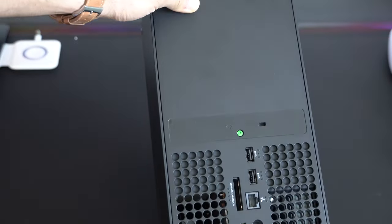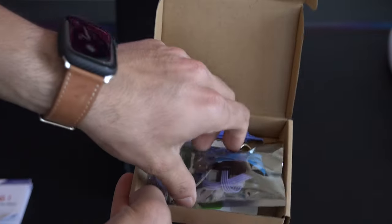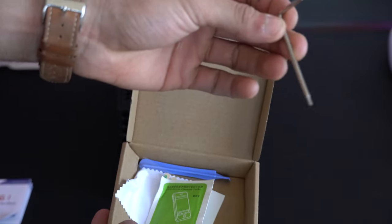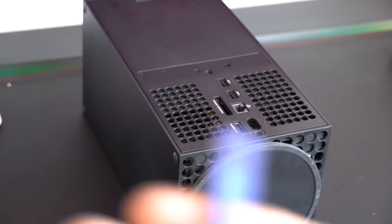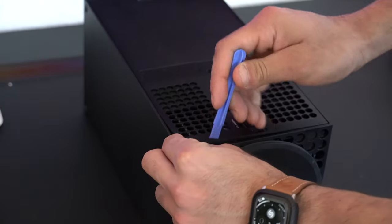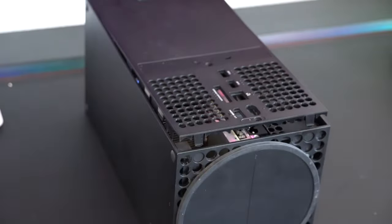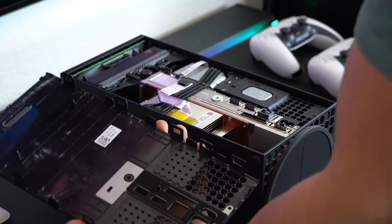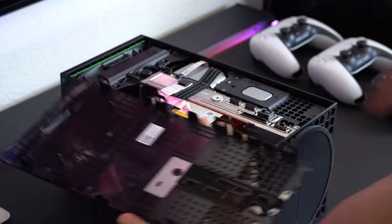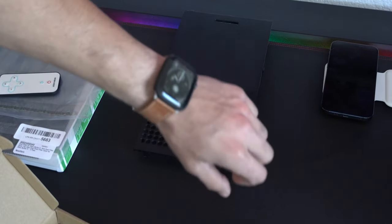Once removed, the screws are actually green, which is quite interesting. They provide everything you need inside the box — everything is included. Set everything aside and start the disassembly. Using the included T8 screwdriver, remove both screws. Then grab the plastic trim removal tool and almost like a crowbar, pull it out, holding it with your finger. Do the same on the other corner — there are two clips keeping the back plate together. Simply pull up, working from the very bottom to the top, and it comes right off. To avoid losing screws, just place them back on the back plate.